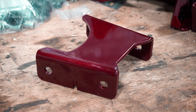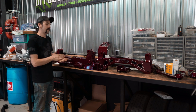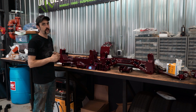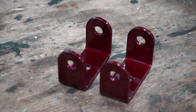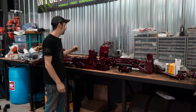Diff drop here, and I know as Brad always likes to say, it's a true 7-inch diff drop, so when it's set at 9, it's a little bit of an angle, but nothing crazy, well within its limits. Back here we've got some brackets for the compression strut, which again is another McGaughys exclusive type of deal.